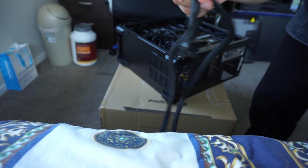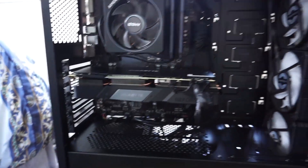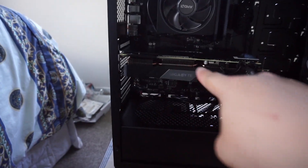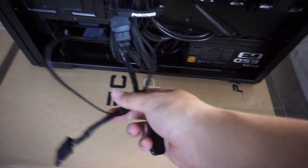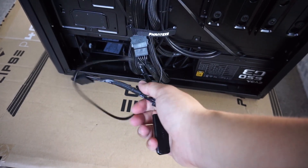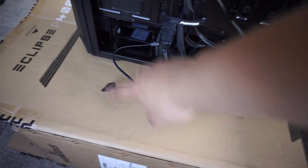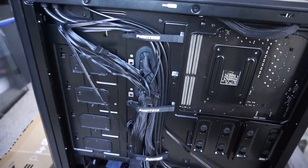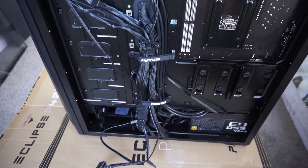I need to redo the cable management. I think I'm done. I've got the graphics card, the CPU, RAM, and the SSD right underneath the graphics card on the motherboard. I got all the wiring done — the wiring's not too bad. You can't see anything at the back. I got extra SATA cables coming out at the back so I can put my internal hard drive in later. Let's turn this on — I have a USB with a Windows installer, so let's see how that goes.